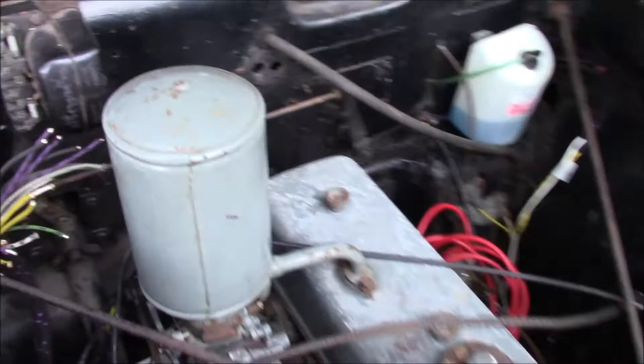Add into that the palaver up here with things not fitting — it's a wonder I didn't throw anything, to be honest. Up underneath the car — apologies for the lighting — this is the inside of the chassis leg and there's the floor of the car. I've found one clip just there, which is bolted on from the other side into what looks like a captive nut, but the bolt head looks round. The tricky part's going to be threading this new wiring through all the various holes in the chassis just to keep everything where it needs to run. I probably won't be able to show you this — if I had a lift I probably could, but just me on the driveway on axle stands, not a hope.